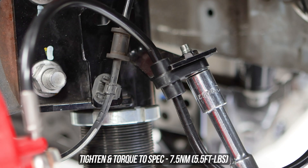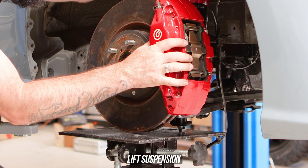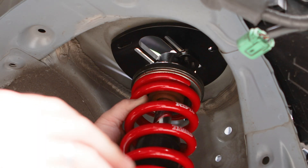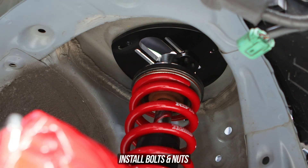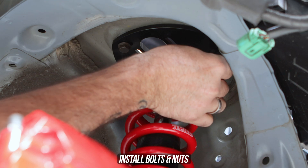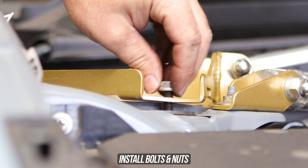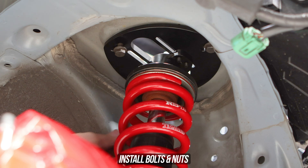Now all that's left is to pump up the jam, lifting the suspension up to the top, which conveniently allows us to finally dive into the one and only adjustment segment. Once you're lining up the strut top holes, throw the bolts through from the bottom and wind the nuts on the top. The bolts that secure the plate to the chassis also have adjustment, and we'll get to tightening those in just a moment.